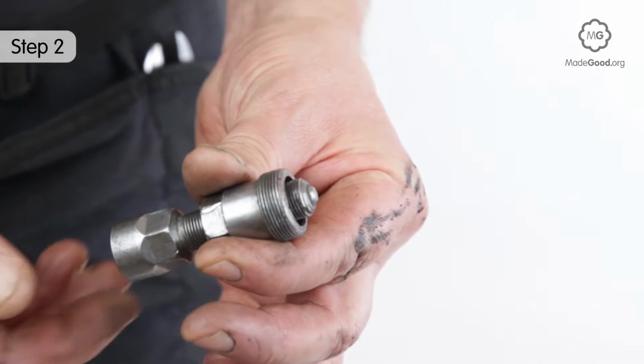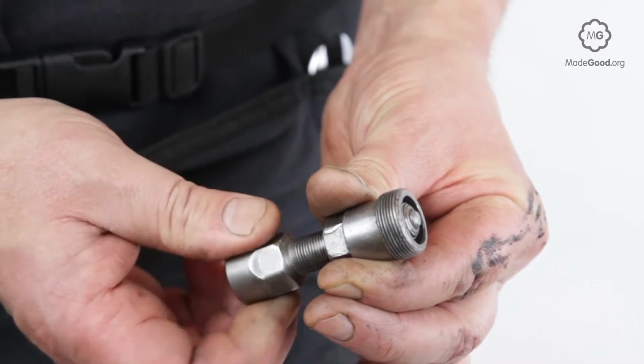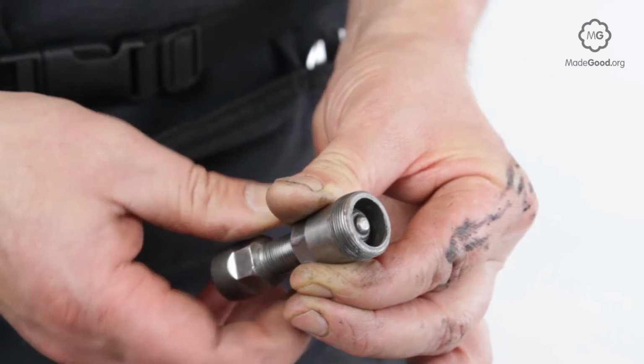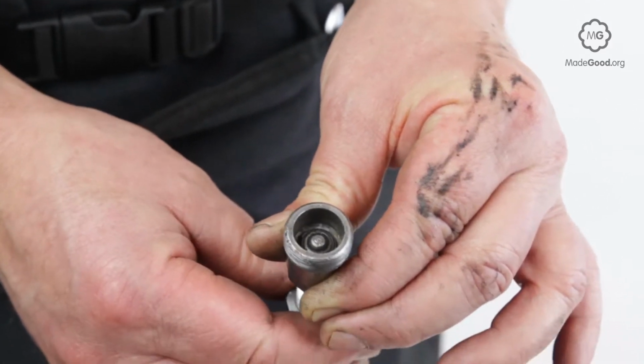A crank puller is a unit that screws into the threads on the inside of the square tapered crank holes. A bolt that runs through it jams against the axle to force the square tapered crank off the tapered axle. Retract the bolt from the crank puller.